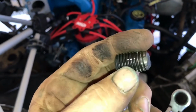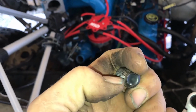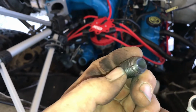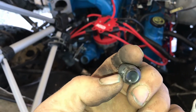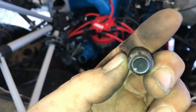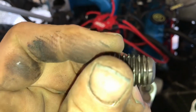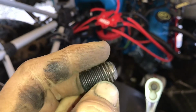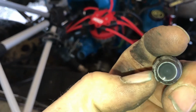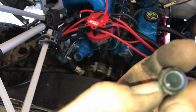and take you a hard bolt, harder than what you're tapping into. I just use grade 8. I'm just cleaning this out. I'm not making a new thread, but if you got a really hard bolt, I mean, basically a tap is just a tool steel bolt that's got flutes ground in it. So you see the cutting edge, you'll rotate like that. So the cutting edge I left alone, and I ground down on this side of it and tapered it up just short of it, and I quit grinding right there.